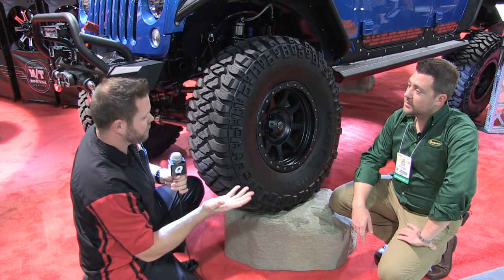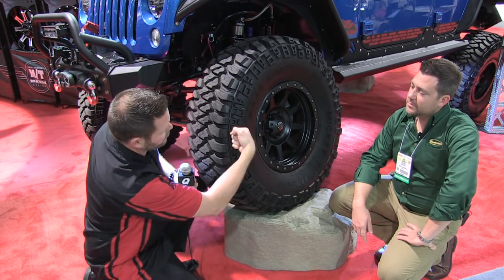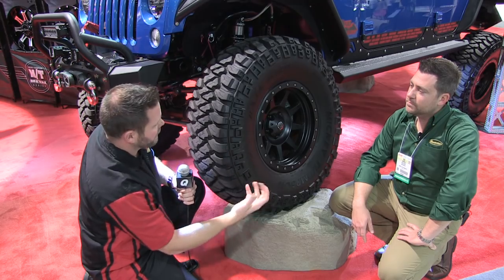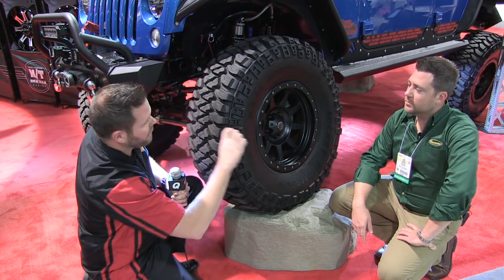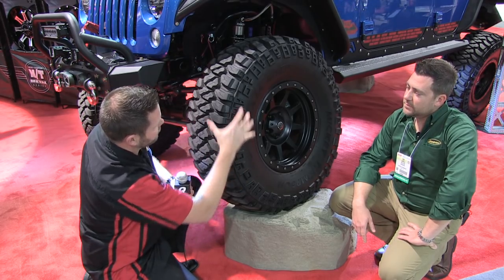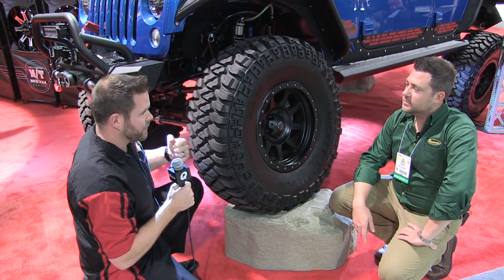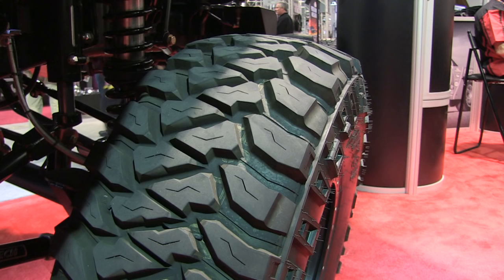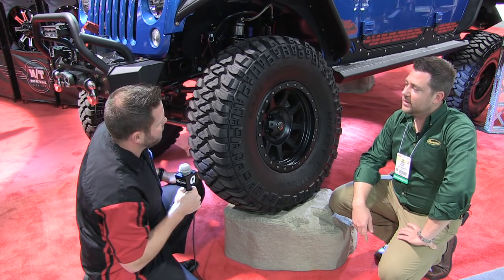It's like a traditional radial tire, but the third ply is actually bias angle. So if you get an impact when you're off-roading, with a regular three-ply or two-ply the force is going to be transferred to just the plies in that area. But with the angled third ply, it's going to transfer the force to a much wider area, giving you better puncture resistance. It's also going to tighten up the carcass so you can react a lot quicker, like in an emergency lane maneuver.